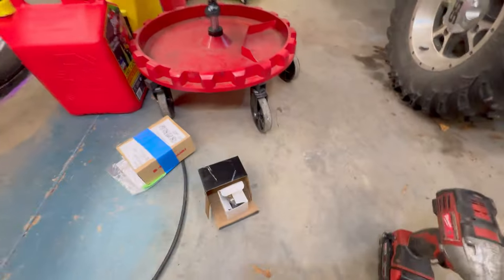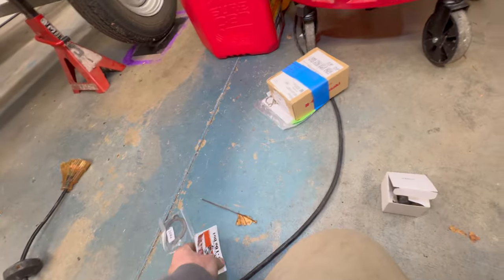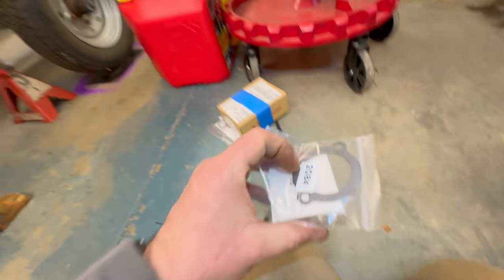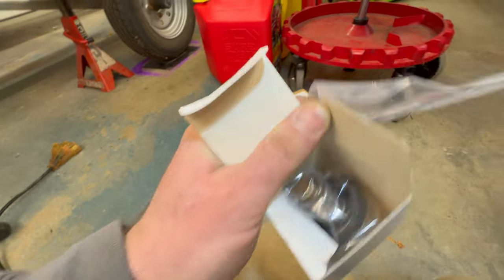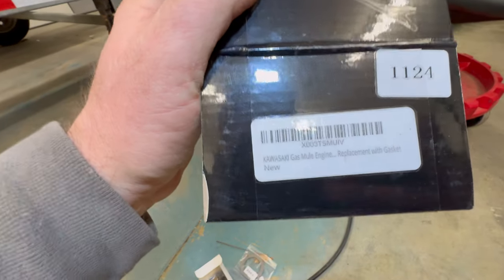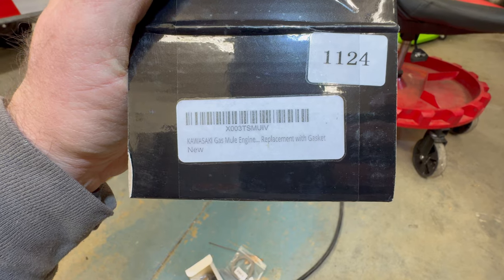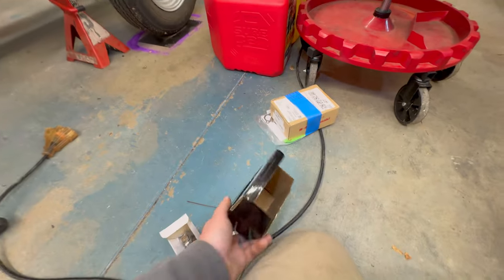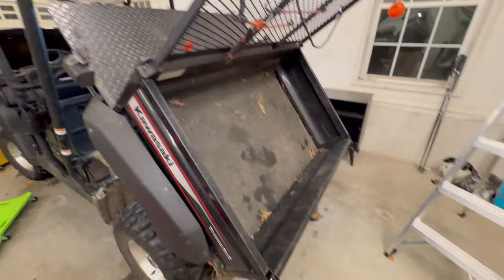You can see the coolant down in there and it's just going to pop right off. The new one should have a gasket if you get a good kit. The kit I got I ordered from atvworks.com, but I believe it came off Amazon. It came with the thermostat itself and a gasket — a nice little all-in-one package. The Amazon part number is X003TSMUIV. Now I'm going to get in there, take the thermostat out, and switch it over.